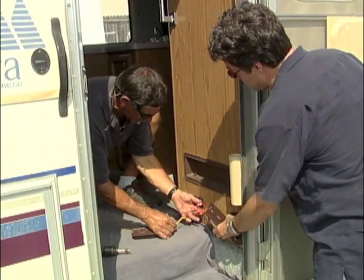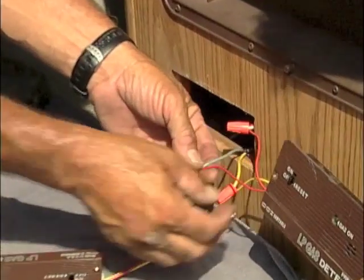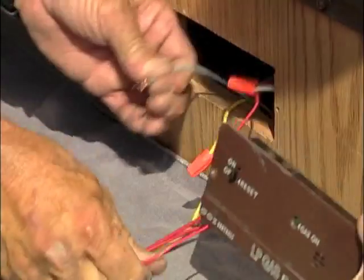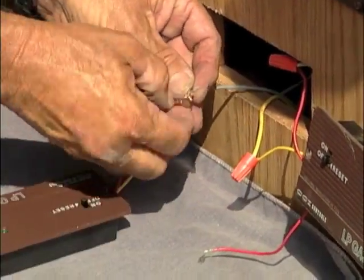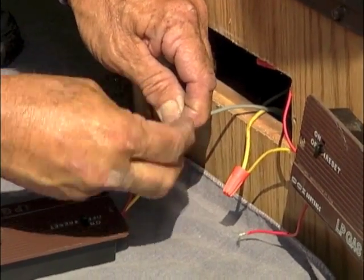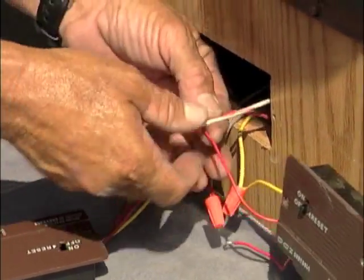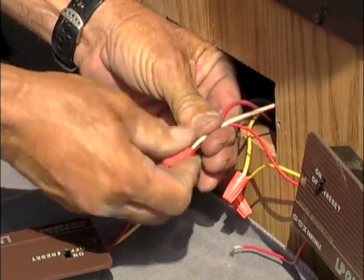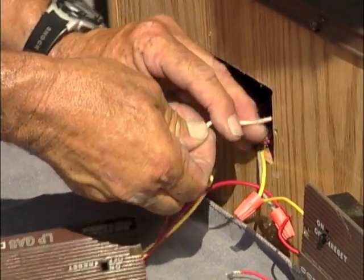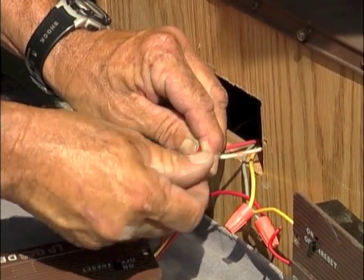You just need to pay attention to your wires. If you take them off one at a time — the red wires aren't polarized, it makes no difference which one the red goes to. Some of them have wire nuts and some have butt connectors; you may have to cut and solder them, but either way it's not very difficult. The two red wires are the hot wires — one's converter and one's battery. Fairly easy installation as long as you've got the wires straight. Anybody can do this.